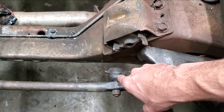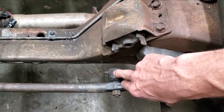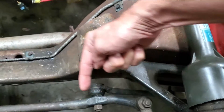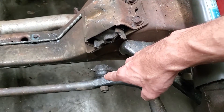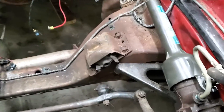The reason why it's spherical on this end is it's designed to be able to turn. So this part — while it shouldn't shift this way — this part should be able to rotate around the spherical end like this. That allows everything to be able to shift and move without there being any play this way. And that's basically how the tie rod end works.